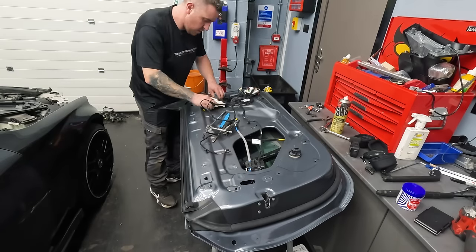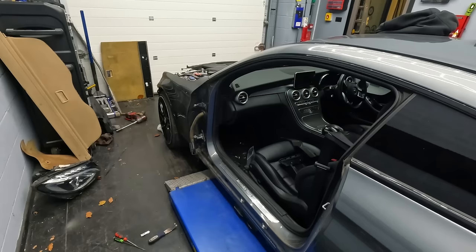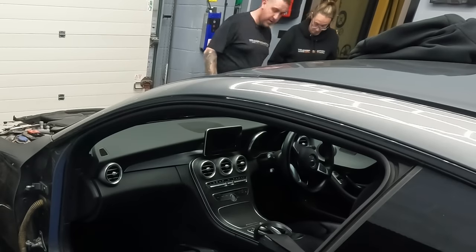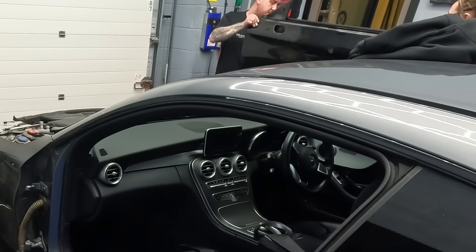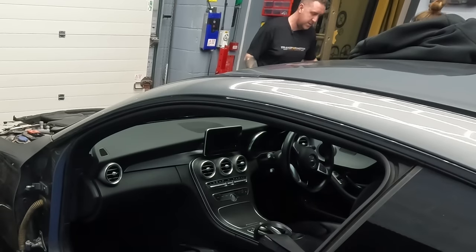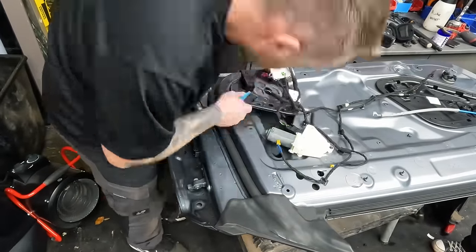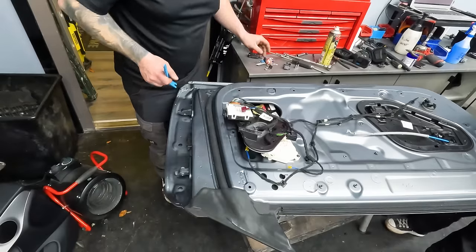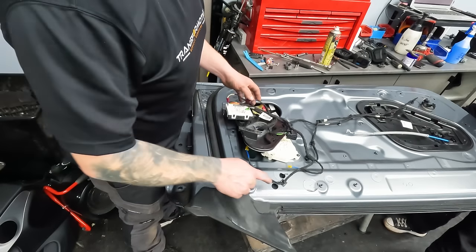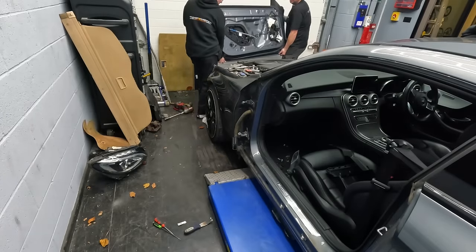The reason I'm doing it this way is that once the window motor goes back on I won't have manual access to put the window up or down. We got the door fitted up — the spiny bits slide into the groovy bit on the hinge. However, there was a rattling noise inside the door. Turns out there was a loose bolt inside — probably dropped from taking the wing mirror off. Once we got the bolt out of the door and there was no more rattling, we got the door back on the car.